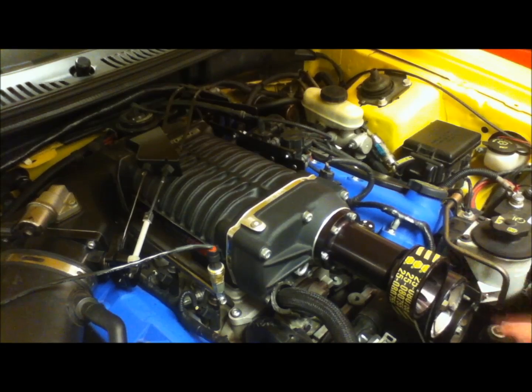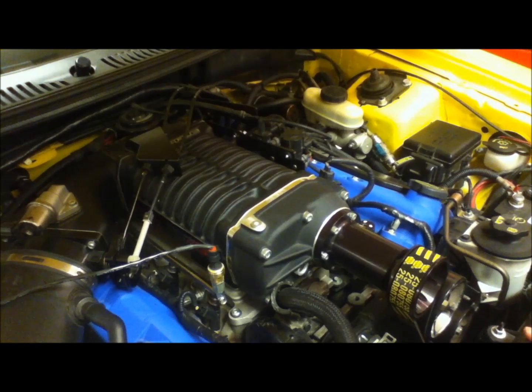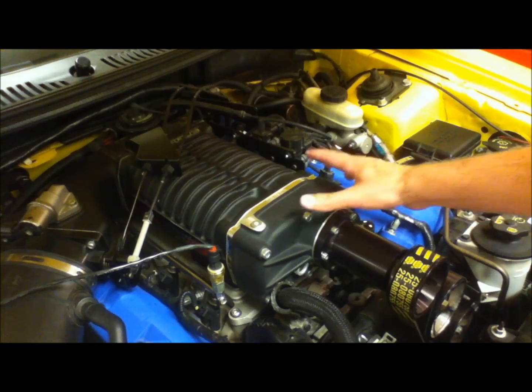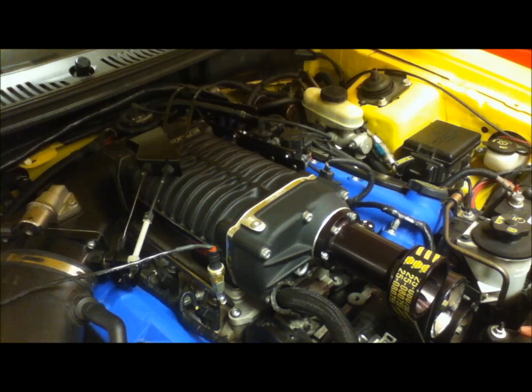The answer is that the engine is now consuming that same increased amount of air. So the supercharger is continuing to produce the same amount of boost at each engine speed under full throttle.